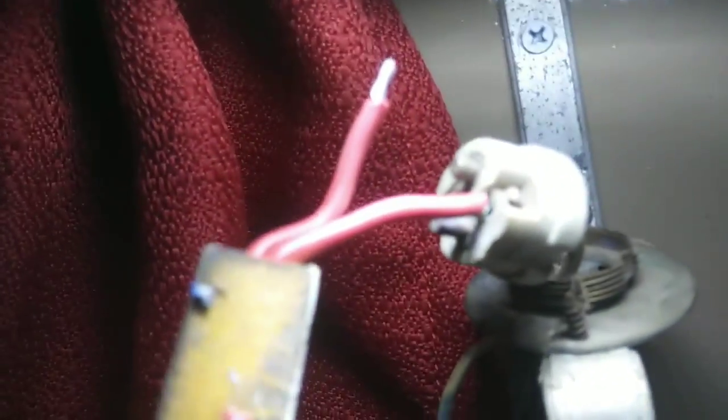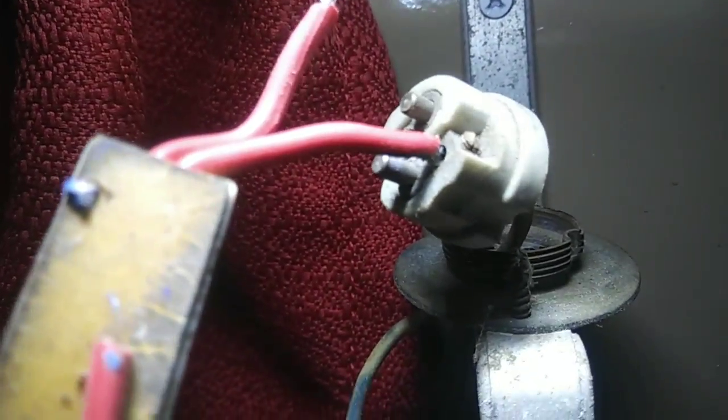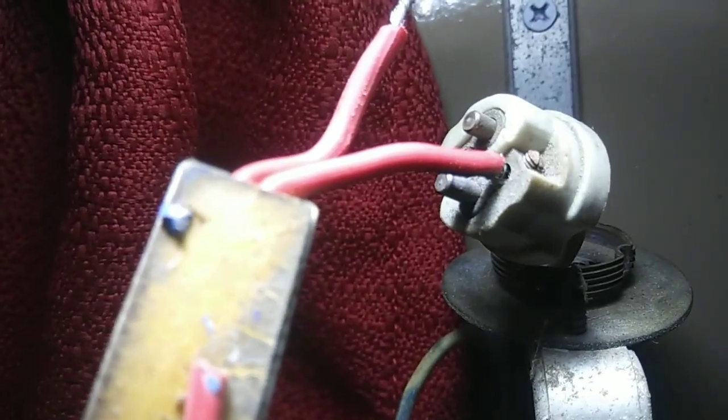Get surgery to the clamshell lights here on the bus. It's pretty wild, and if you can even see that, it's tiny stuff. There's a little screw head. There's all this German manufactured stuff, and they put a dual filament 1156, which you can't get in LEDs, and I want LEDs in here so that I don't use up too much battery power.